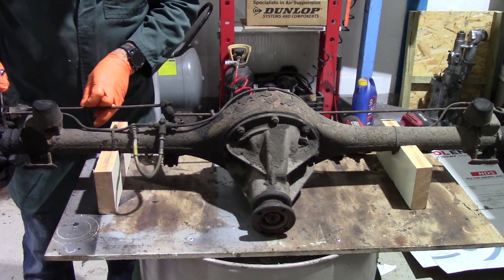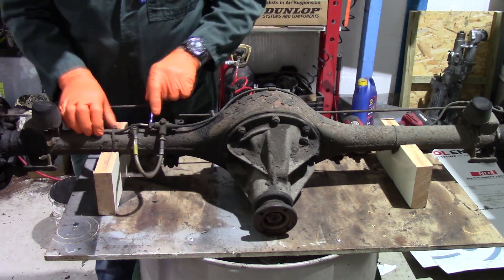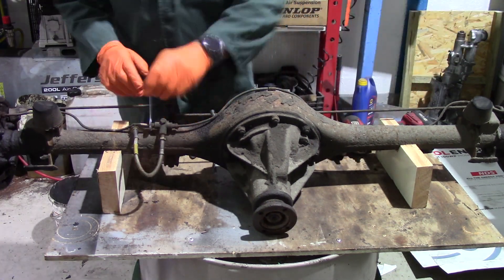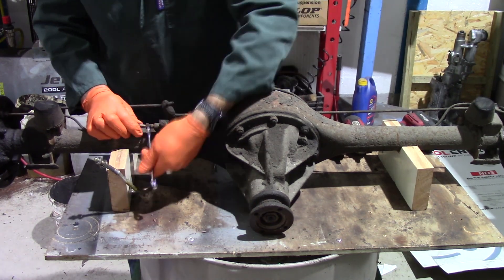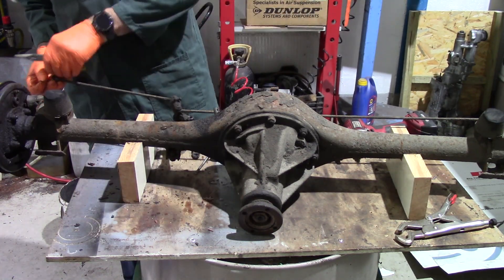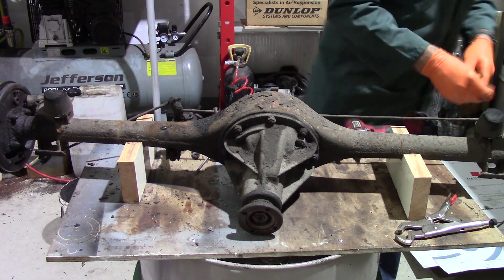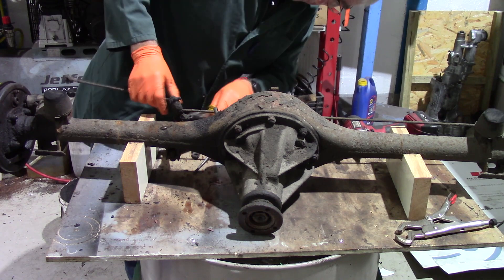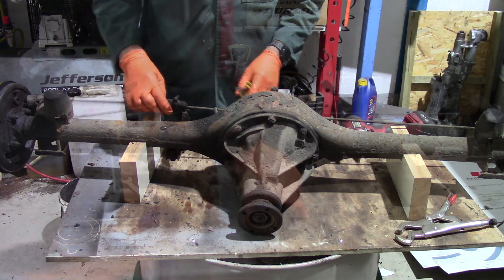Right, that's a bit of background on Project Morty - let's get on with some work. The first parts to come off are the brake pipes, so a 7/16 spanner and undo the unions. A couple of the unions jammed in the pipe, so I cut the cable ties off the pipes to the axle and undid the other end, then unscrewed the pipe complete with the union from the wheel cylinders. I didn't want to cut the pipes because I wanted to use them as patterns for new pipes on the rebuild. Next parts to come off are the handbrake linkages - simple pull rods off the compensator to each drum, held on with clevis pins with R-clips on the outsides, and the compensator ends are split pins through the clevis pins.